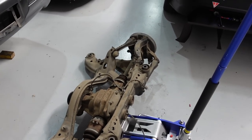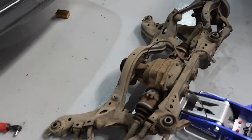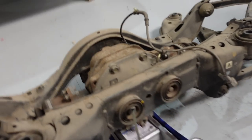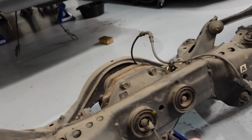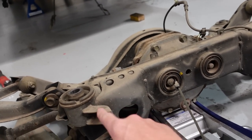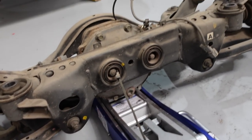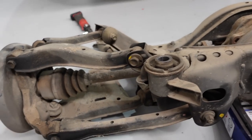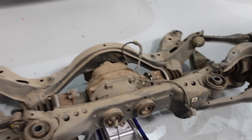As we can see here, the subframe's out. I have to strip pretty much everything off it - I've got to get all the bushes out too, because you obviously have to weld plates in here. There's a few things I'm going to cut off as well. I'll get all this cleaned off, get everything stripped, and then hopefully there's room in the fab room next door without interfering with Rob. I can get busy and try and smash this out today, see how we go.